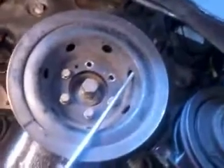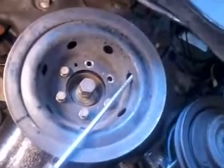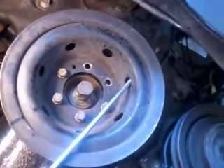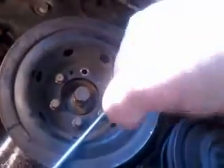We've already removed the serpentine belt, which you can easily do with this thing called a dynamic tensioner. It doesn't have an adjustment really, it just self-adjusts. So you just take a socket and maybe a breaker bar — the end of it is a ratchet — and just loosen it; it's up in here. You loosen the tension and slip the belt off.